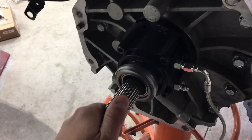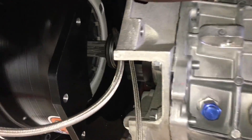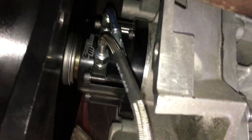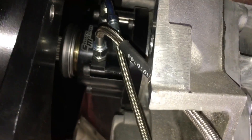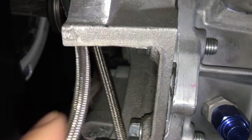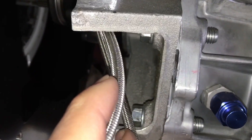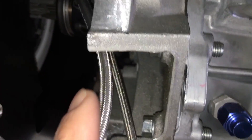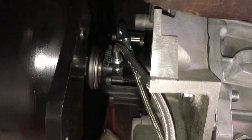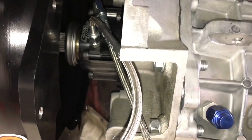Now that the trans is lifted up and almost ready to go on, I installed my feed line. One thing you need to do when you push this transmission onto the bell housing is make sure you do not pinch any of your lines. I usually put them right through this pocket on the T56 Magnum front case — make sure those lines stay in there and just be real careful as you push the trans on. Other than that, this is going to be pretty quick and easy.